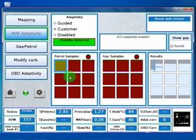The meaning of this kind of adaptivity is that the installer can make just an auto calibration and a little bit of checking, and then he can give the car to the customer, so he will drive the car on petrol until the ECU gets enough samples, and then it will switch automatically to gas. So this is very useful in conditions where the installer cannot drive the car by himself, maybe because he is alone, or maybe because he lives in a very trafficked area, or something like that.